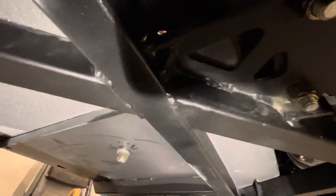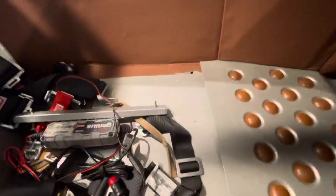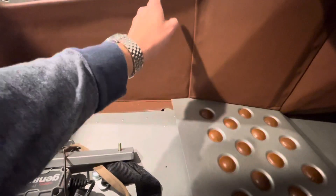I think the only way to get around this is to make a relocating bracket. You can see where the seat pan is, how far off that is. When you come over here and look at this side — that's the position right there. If you move it this way, you hit the frame tube. If you move it this way, you're more on the transmission mount. If you move it this way, you're on the other side of the transmission mount like the driver's side. If you move it here, you're behind the mount. There's really no good spot here.